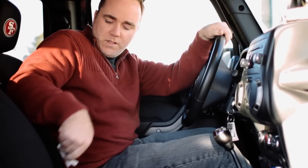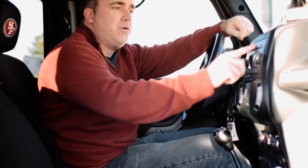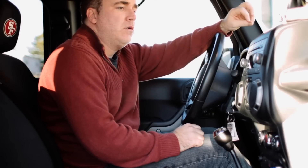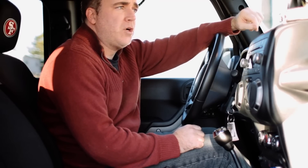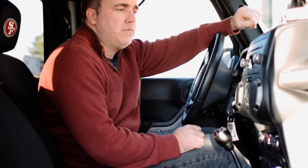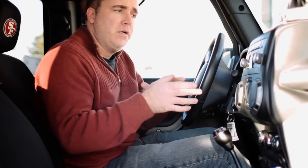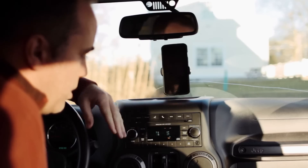Make sure the file is on the drive, eject it, and bring it out to your Jeep. Insert the USB into the center console USB port, then press the Uconnect phone button. You'll hear: 'iPhone connected, Uconnect phone ready, setup software update starting, software update process, please wait.' It may take a little while — you'll hear a series of beeps and it will say 'SW update started.'